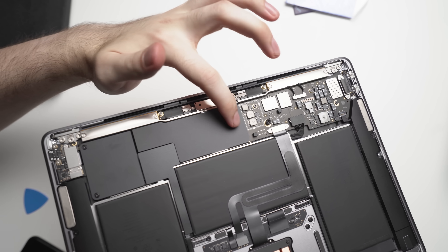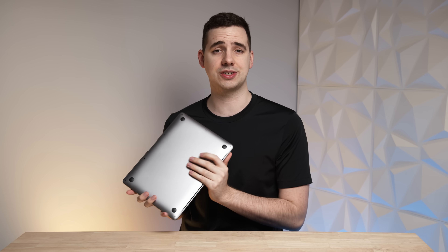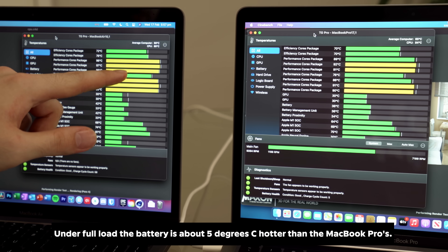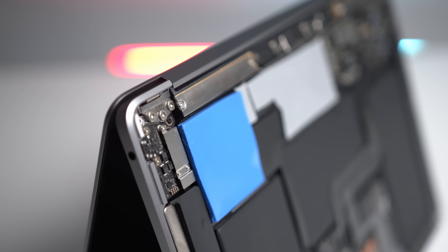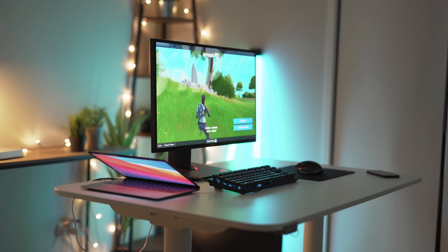Some people expressed concerns about the battery. What the mod does is draw all of the heat away from the CPU and GPU and distribute it into the chassis. The battery is located towards the bottom of the MacBook, while the heat is mainly concentrated around the CPU up top. Secondly, I only spend about 2 to 3% of my time using this Mac where it's actually quite hot. So there's really not a big risk of the battery overheating from this mod. That said, if you're doing a lot of gaming or rendering where the laptop is constantly hot, I wouldn't recommend this mod as it probably isn't good for longevity.